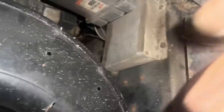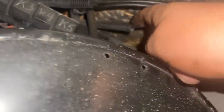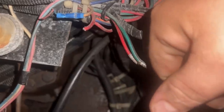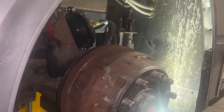We got into the power panel here. This is supposed to be able to bypass it with this button with the ignition switch on, and you ground out the low oil sender in the back. We couldn't get it to work with that — it runs by air pressure as well. I followed this cable back into this wiring harness; it loops around a whole bunch of times back there, comes out, and they've cut the fuse out of it. Something happened that they wanted to remove the fuse so there was no power. I bypassed it and added power with the power probe and it still didn't work. So we're just disconnecting it and running all grease fittings on everything — slack adjusters, S-cams, all that stuff.